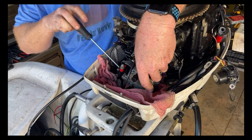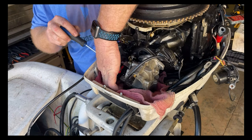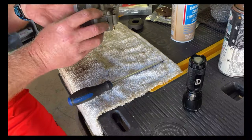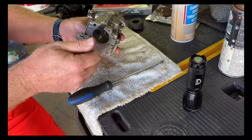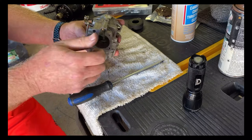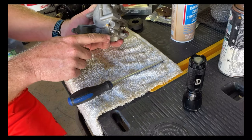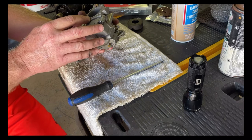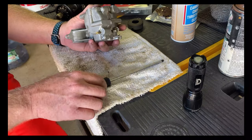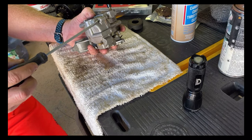I have an electric choke mounted to the carburetor body, so I'm going to take that off — it just makes things a whole lot easier. The carburetor is out. Here it is on the bench. You can see the drain plug for the bowl on the front. The bowl is this part down here and here's the top part of the carburetor with the idle air adjustment. Now we're going to take the bowl off — four screws. Be very careful because there's a gasket between the bowl and the carburetor. If it's older it may come apart, so best to have a carburetor rebuild kit handy before you start this project.